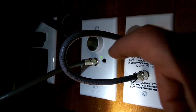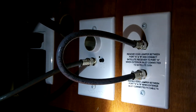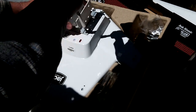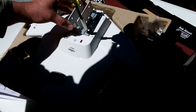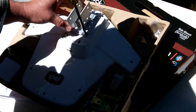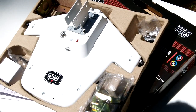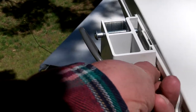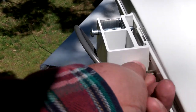To replace the antenna, first turn off the antenna power at the wall switch and raise the existing antenna. Now attach the RV antenna bracket to the Jack antenna with the four supplied lock washers and screws. Next, unscrew the coax cable and remove the existing Sensar antenna from the retractable arm.